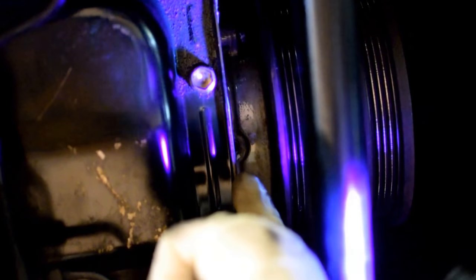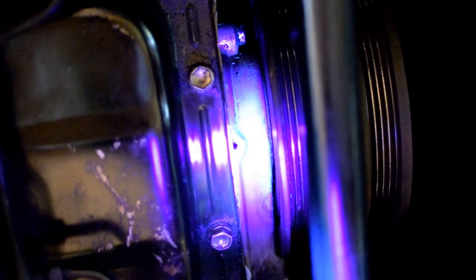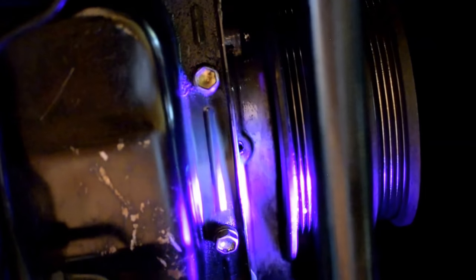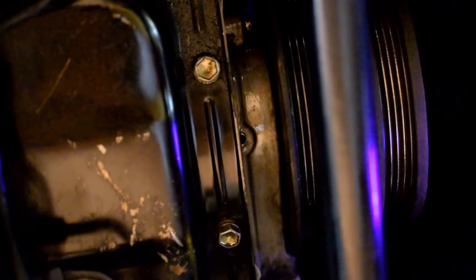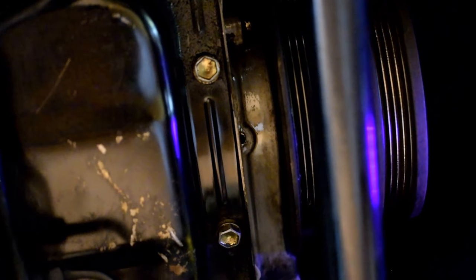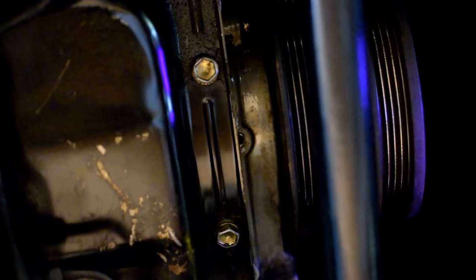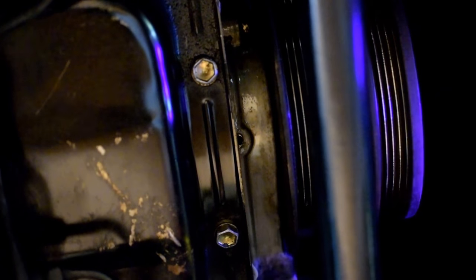I can't really tell — it looks like there's still a good amount dripping down the center. There's a little weep hole in the bottom of that timing case because they suspected you would get an oil leak there. It's better for that oil to leak out of the timing case than to sit there with the timing gear and the bottom of the timing belt. We are at the point now where we can take off the crank bolt. I've got an impact gun that I'm going to try to use, and hopefully that will crack that baby loose.